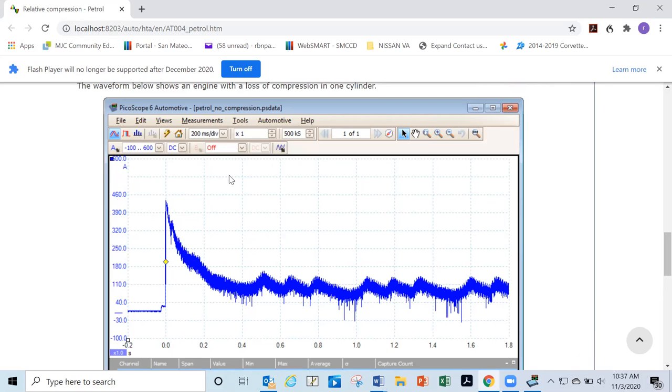Or in other words, wherever our switching device connects to, which would be the negative side of the coil. Even if it's a 2, 3, or 4 wire coil, it'll always have a negative side. Again, the side that goes to the switch. The only thing you've got to be careful with is that sometimes coils, especially the 4 wire variety, might have a ground which is just to ground the module. And then they'll have a ground that goes to the switching device. That's the ground you want, the one that goes to the switching device.